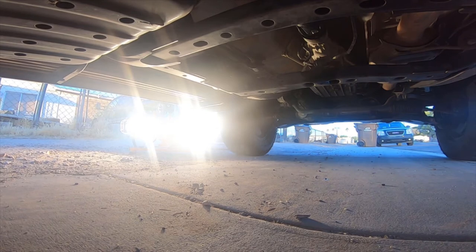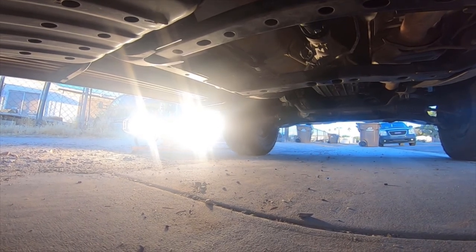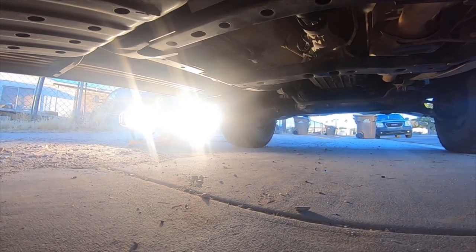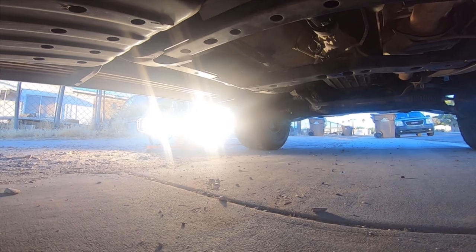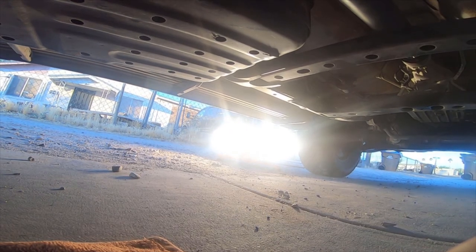I do not think that 1/4 ounce times 2 grease zerks are gonna actually throw off the balance, especially since the welded balance marks, there's like little metal discs welded on. I don't know if you see that, but those are also facing down. And on the rear, it's actually facing the gas tank. I'd say it's 20 degrees off from down.